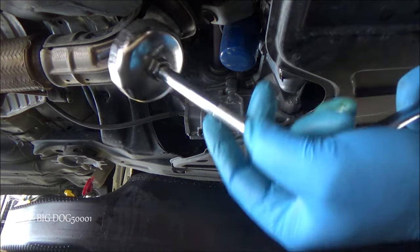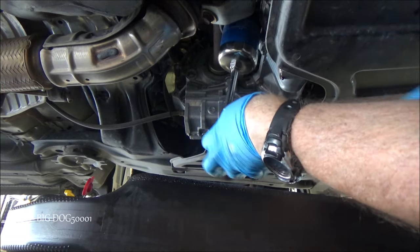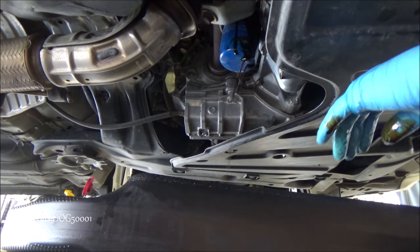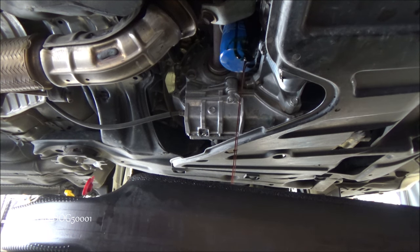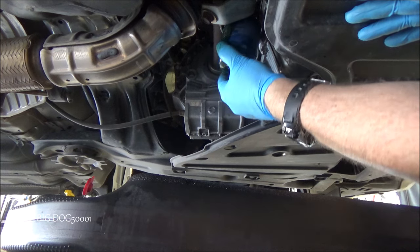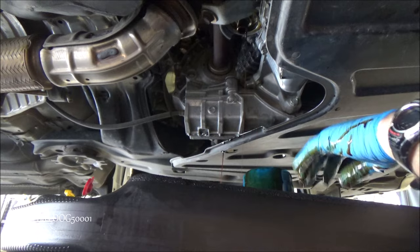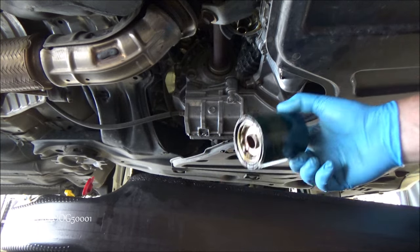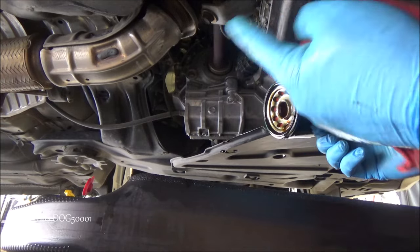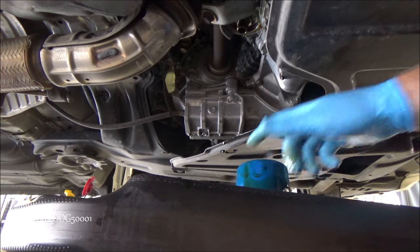While the oil finishes dripping, I'm going to pop the oil filter loose using a Honda oil filter wrench with an extension on a ratchet. I'll crack it free, loosen it up — it's going to start dripping, so I'll let that drip for a bit to get most of the oil out before I grab it since it's warm. These things always get slippery so try not to drop it. It's also a good habit to always make sure the rubber o-ring stayed with the oil filter. On Hondas they typically stay on, but always take a peek so you're not double-gasketing when you put the new one on.